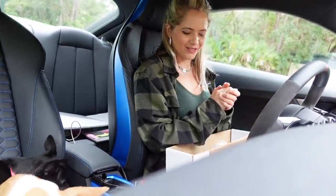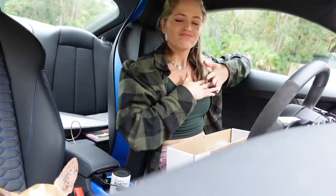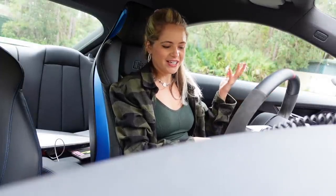Okay, the other thing that I have to fix is something that I did wrong. Luckily, I have you guys looking out for me, calling me out when I make a mistake, and I did not know that Audi subframe bolts are one-use stretch bolts. No idea. Luckily, I got some Audi techs here on the channel looking out for me. And ironically, 034 had already sent me these subframe bolts to replace in my car when I dropped everything and reinstalled the subframe. So, yes, I'm aware. Thank you guys for letting me know. And that is what I need to fix today.